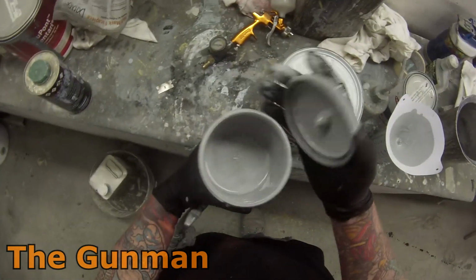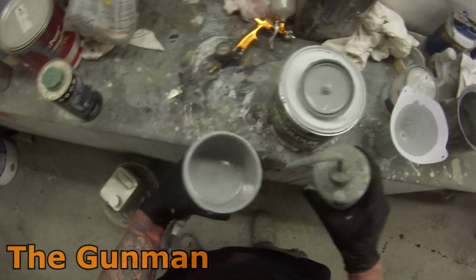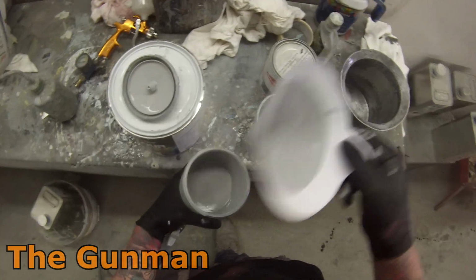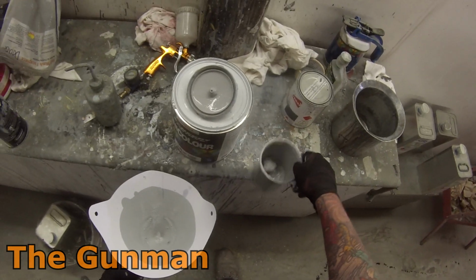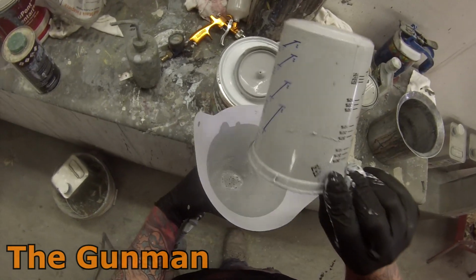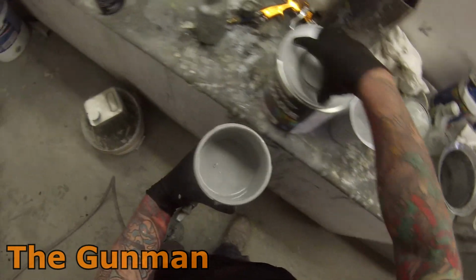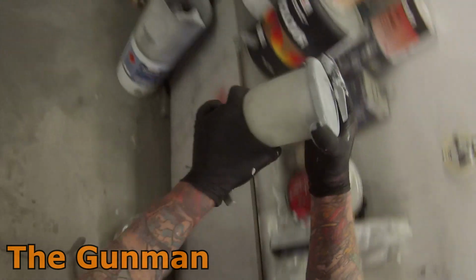Look, the way I look at it is there's probably a reason why 95% of all primers are light grey, because it's probably chemically the best primer to use, and it's a good universal ground coat, I have found anyway. Anyone who's tried sanding a bit of fresh clear will know exactly what I'm talking about. It just clogs your sandpaper straight up. Obviously once it's dried out, for a month, it's fine to sand.